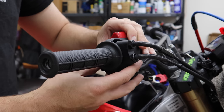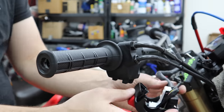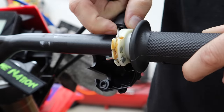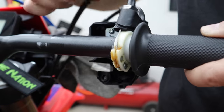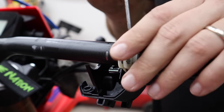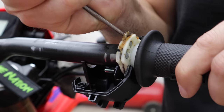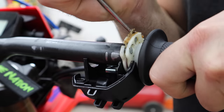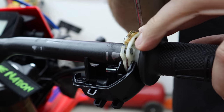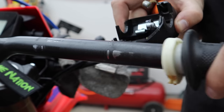You're going to have some fun in here with the throttle cables. Start by getting the housing off. There's the side with all our electronics — I'll slip that over. This is already bottomed out on adjustment, so I'm going to use a little pick tool to get underneath this cable. I need to be real careful not to fray it. Work it up, find the spot to get it off — there we go. Now push this little barrel end out, and with that off, remove the other cable the same way.